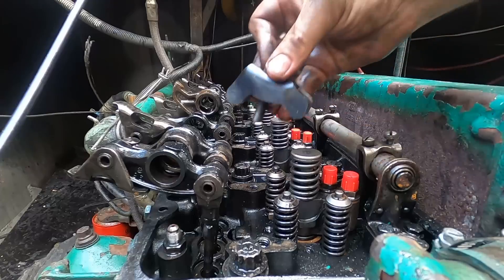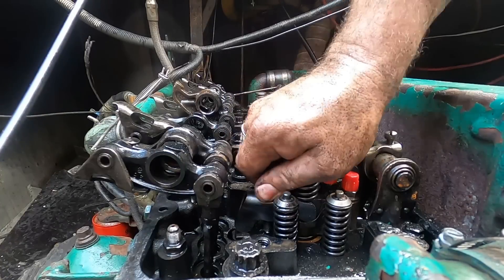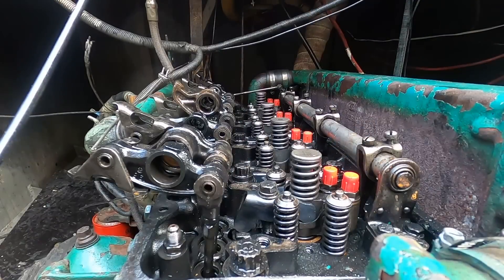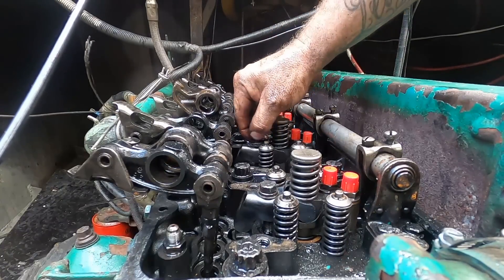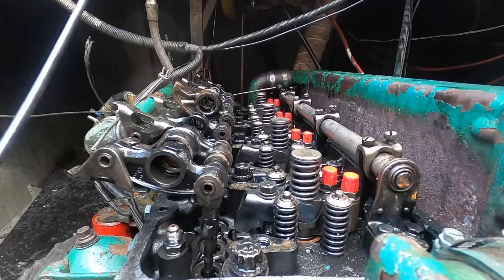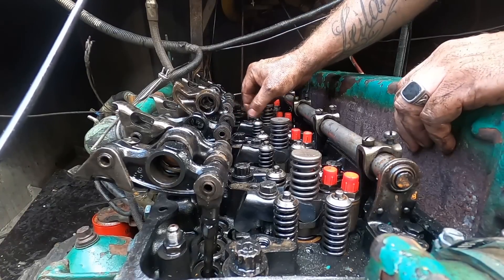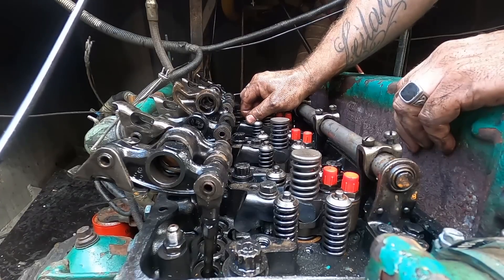These are the injector clamps — they just sit either side, one bolt in the middle. They're only down to 25 foot-pound. Otherwise you can damage the bottom of the cup and you can also start damaging the bottom of the head too. There's a fair bit of cast there, but if you really got carried away and went stupid, swinging off it, you'll probably do some damage. Stu, you have to remember all this for next week when we do yours.